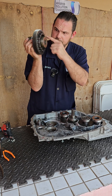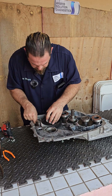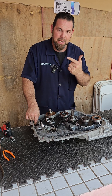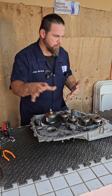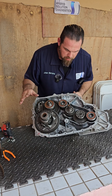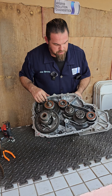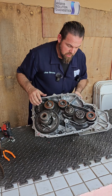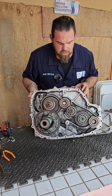Here's the counter gear and parking ring gear. If I activate this little pin and put it in park — look, the vehicle can't move. Mechanically, this little motor activates the pin and releases Motor Generator Number Two to freely move the vehicle via the differential. There is no oil pump — nothing. Everything is auto-lubricated by the very movement of the gears inside the e-Power transaxle. This side is for Motor Generator Number One: if I spin MG1, the only reaction is to move the internal combustion engine.